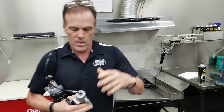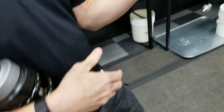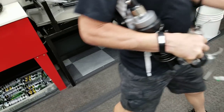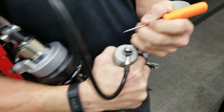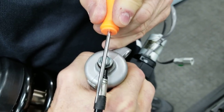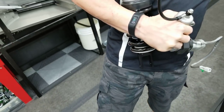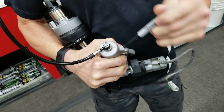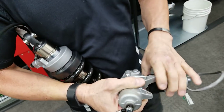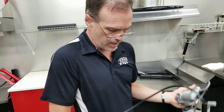And that's important. Now, before we do anything, it's very important on the pump motor: take a pointed object, a pick, and scratch a line into the housing to denote the clocking of the line. You have to put it back exactly where it came from. The first inclination is going to say, hey, why don't I use a marker? Well, if you put a marker there, as soon as you spray any cleaner on it, the marker goes away and now you've lost your mark. So be sure not to do that. Actually scratch the surface and that will make sure that you get it right.